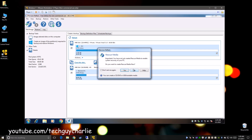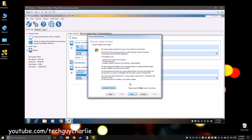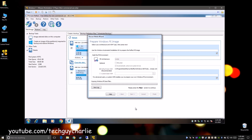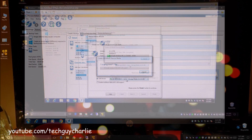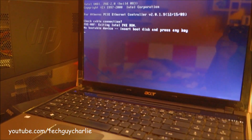Now run the Reflect software. We need to create a rescue media so we can boot up the laptop from the USB disk. Go to Other Tasks, select the first option which says 'Create Rescue Media,' click Next, Next, Next again. We don't need to update that. Select the second option which says 'USB Device' — the Sony Storage Media — and click Finish. The virtual machine is now copying the recovery files onto the removable disk, which we will use to start the restoration process on the laptop.